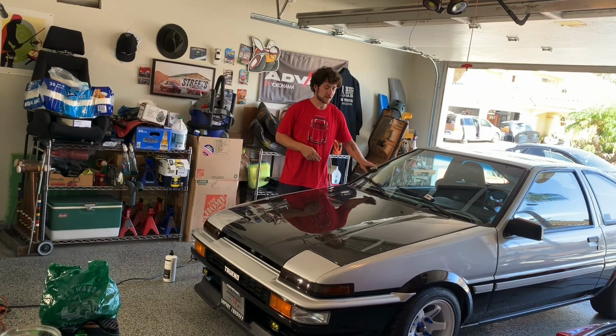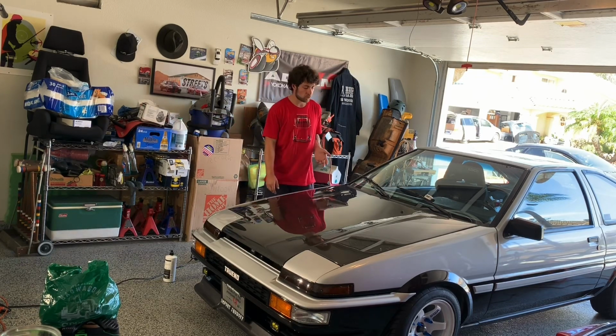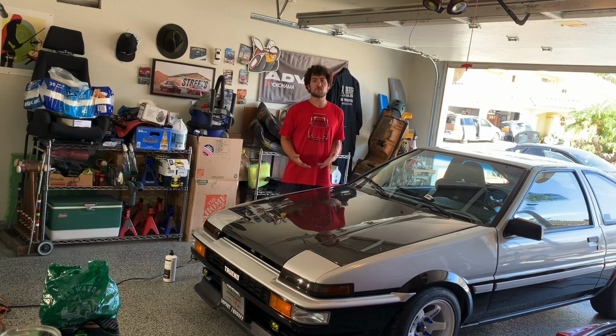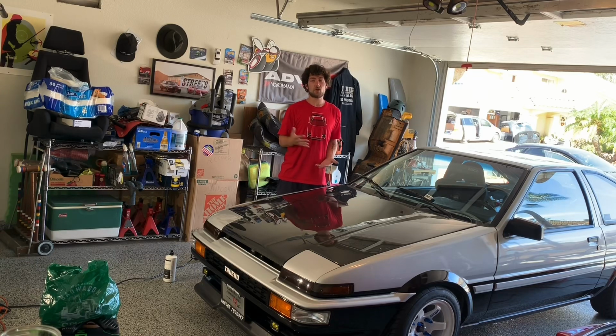That is what the second stage of polishing is for. Using a fine polish and a foam pad removes that DA haze and leaves you with that really nice finish. However, that doesn't always work. Sometimes you can leave so much haze that it's hard to remove. There's so much science behind paint correction, and it's all doing test spots. Every car is different.